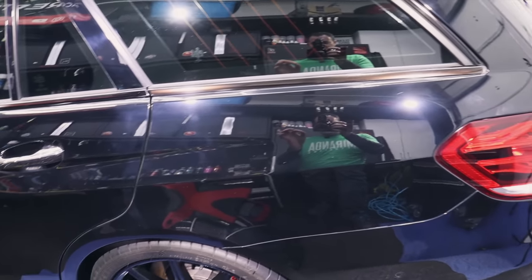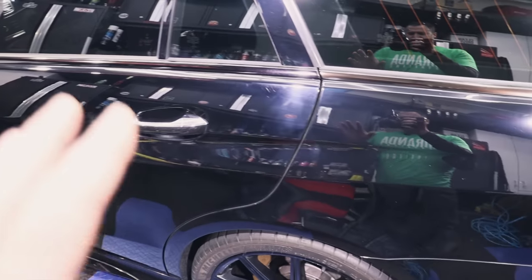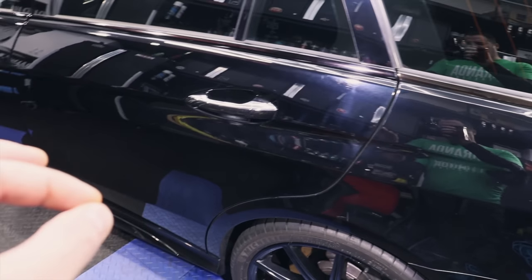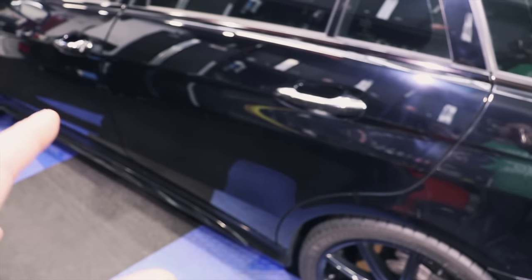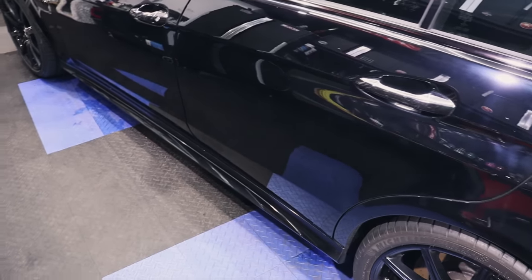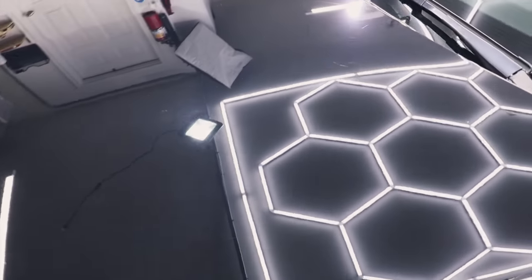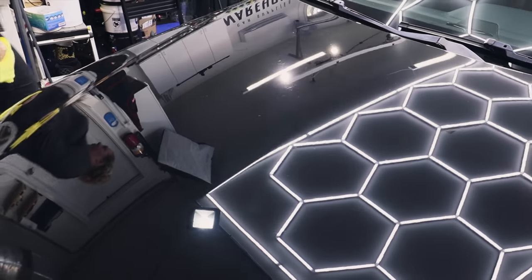So now with everything cut, very, very heavy. We did go pretty heavy, but we're taking measurements along the way. There are some areas that have some other defects and some lighter scratches that we lightened up, but we can't go any further because they are thin areas on the paint. And it is looking incredible. Look at how the paint looks compared to what it was before.